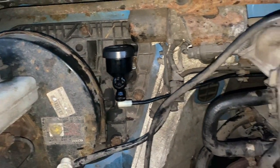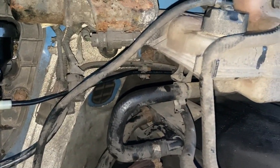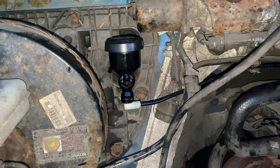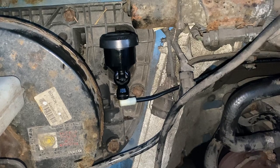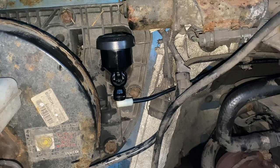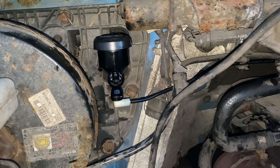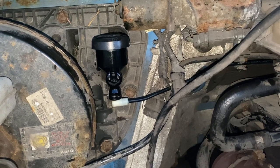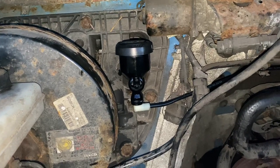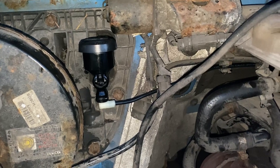And there we've got the new master cylinder. Piping going under the water bottle. Just connect it at the clutch pedal. Do not press the clutch until it's all fitted, or you'll snap the little white prongs which help it bleed. But once we've got it all bolted up under the side, the clutch pedal connected, just touch the clutch, it breaks the tangs. That gives you a clutch pedal.